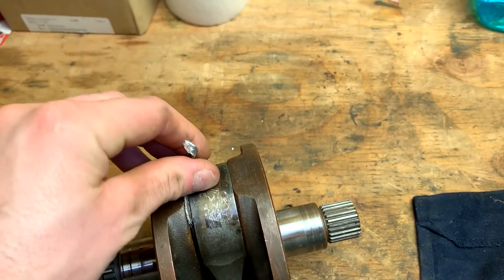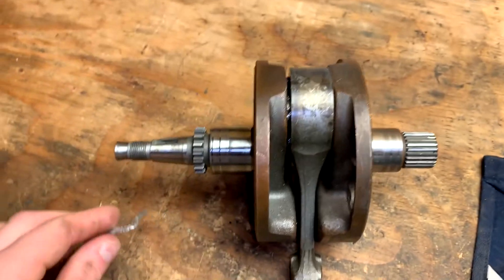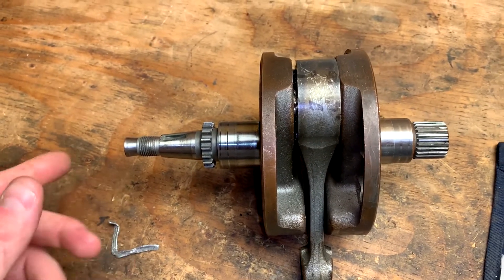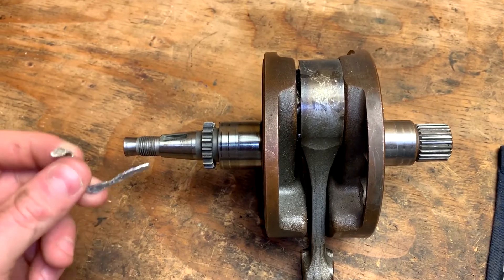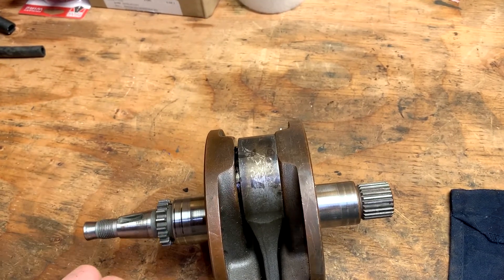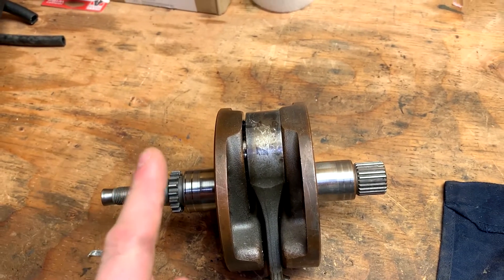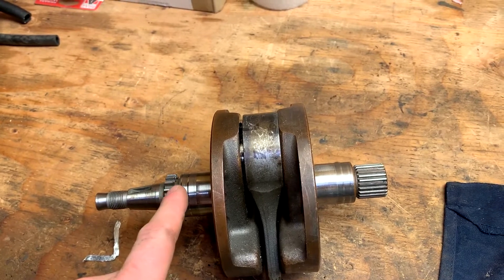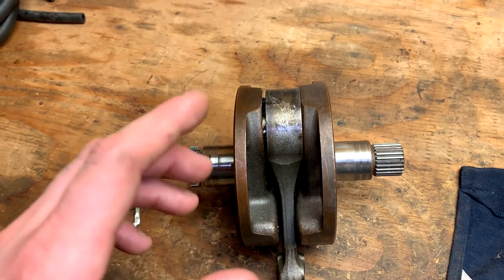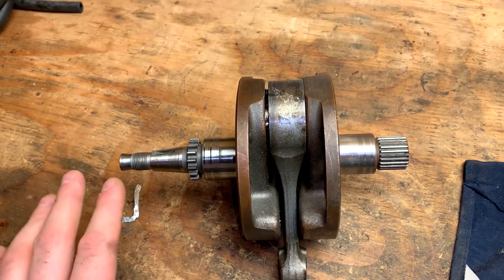You have one thrust washer on each side — they look like just a giant, really thin washer. This is a piece of one, for example. On the 2004 and 2005s with a crank failure, you're going to find essentially silver glitter in your oil filter and in your oil. You'll also get a few little chunks of metal as well. If you're lucky, you won't lose these in the crank and jam up your crankcase and destroy your case halves. You could sometimes get away with reusing the left crankcase as long as it still has a press fit on the left bearing.